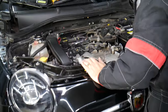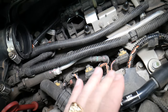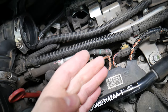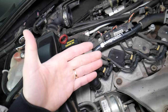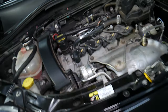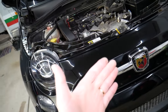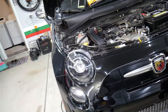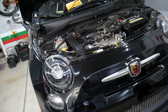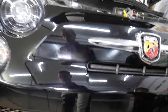What is the knock sensor for? It's usually installed on the engine block or the cylinder head, close to the cylinder head, and it detects premature early detonations in the engine. It can tell the engine computer if it needs to spray fuel a little bit later, or if it needs to adjust the variable timing, so you have a nice clean running engine. Not all gasoline is the same — one gasoline will have a certain rating, another will have a different rating, and as a result one will explode a little bit earlier and be more unstable. That's what the knock sensor is for — it's super important for the normal operation of the engine.